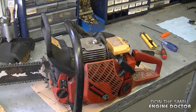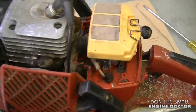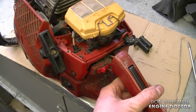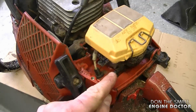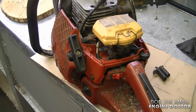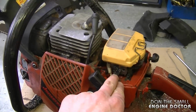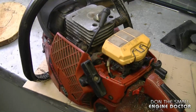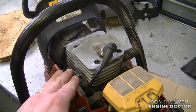So I'm really glad with the outcome. All I did with the screws is turned out the H screw just a bit to give it more throttle. It wouldn't really go full throttle at first, but as soon as I turned it out maybe 1/8 of a turn, everything went up. And also I gave approximately 1/8 of a turn more on the low screw, and everything's good.